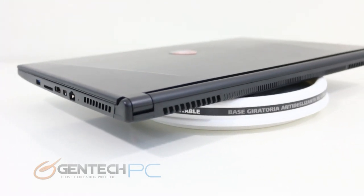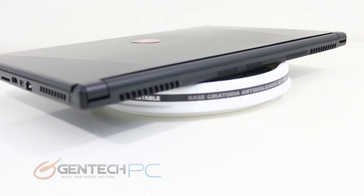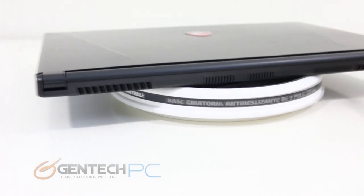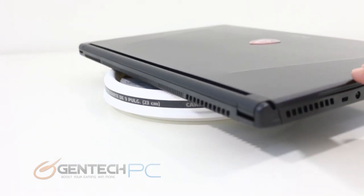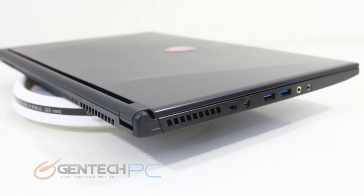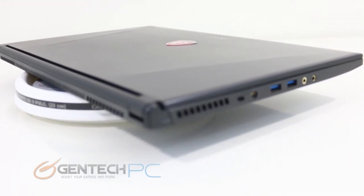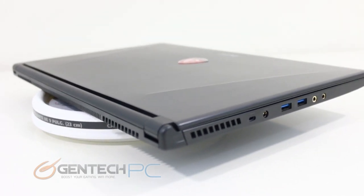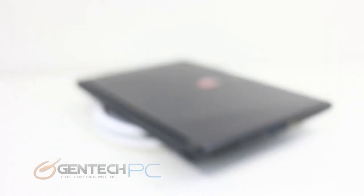What is surprising and yet a very important feature is that the GS60 is actually a dual cooling fan system. On the left hand side you'll see vents, and you'll also see equivalent vents on the right hand side. One of the issues you always face with laptops is heat, and when you make a laptop smaller, heat becomes harder to manage. Having a dual cooling fan system keeps the GS60 nice and cool where other laptops might have failed. The entire back side of the GS60 is dedicated entirely to the exhaust area for those cooling fans.